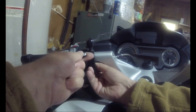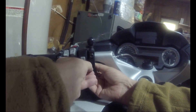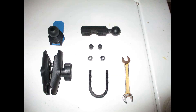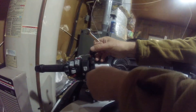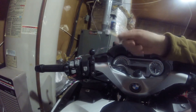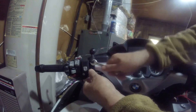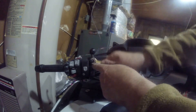We attach that with two self-locking nuts, which I will do loosely right now — just like that, and the other one on there like that — and then tighten them down. Using a very old worn-out 11 millimeter wrench, I'm going to tighten them down to the appropriate torque setting, which is just tight enough so it doesn't move. I do this one turn at a time on each one so I get an even tightness.